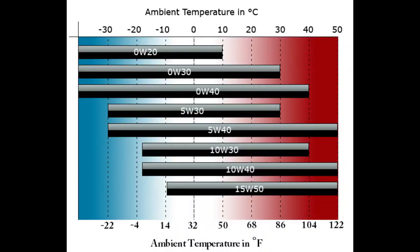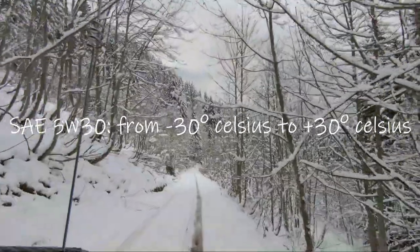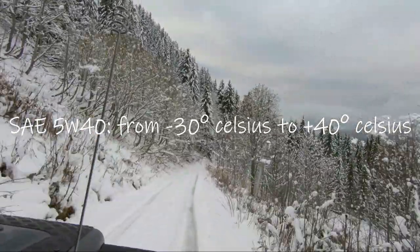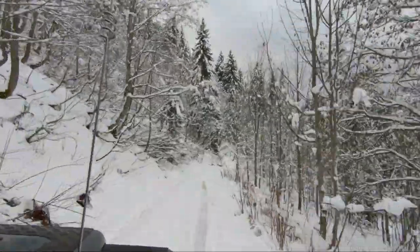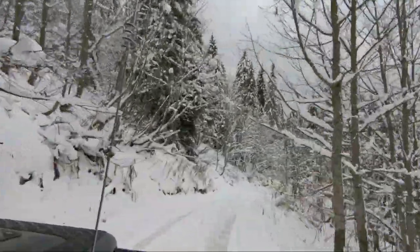Now, why are we using a 5W40 for years and not a 5W30 oil? The major difference between the 5W30 and the 5W40 is the temperature range. So you might think about it depending on the climate zone you are located in or where you plan to go. The SAE 5W30 goes from minus 30 degrees Celsius to plus 30 degrees Celsius, and the SAE 5W40 goes from minus 30 degrees Celsius to plus 40 degrees Celsius. The 5W30 and the 5W40 have the same negative temperature range, but the 5W40 positive range can support higher temperatures,